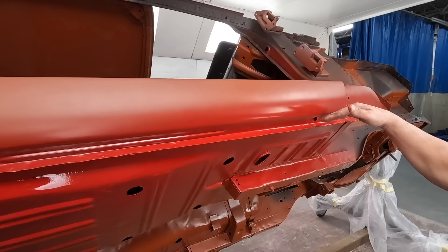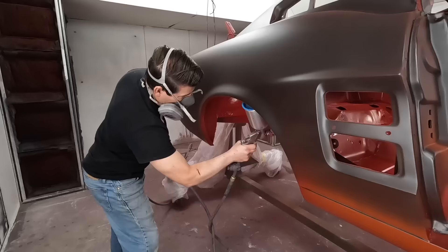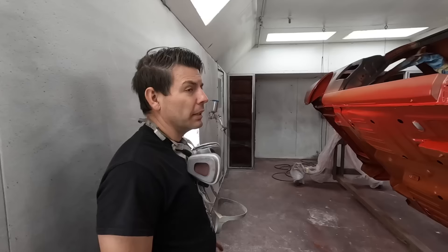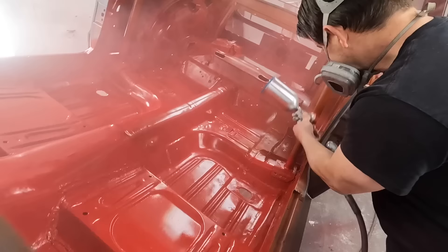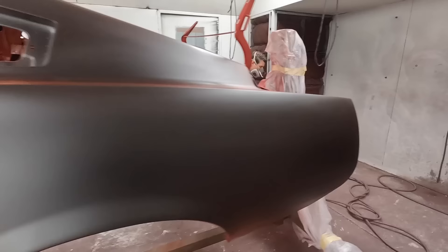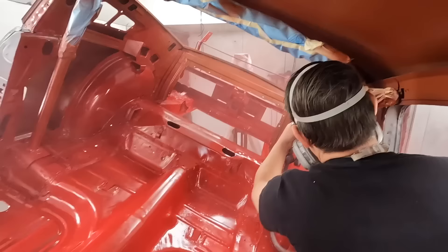See the overspray transitions across the floor pan - I'll go back and spray that black, and then you'll have black overspray on top of that a little ways. That'll have to be sprayed later, taped off and just sprayed. I have to put another coat all in the wheel tubs and the trunk area, and after that dries thoroughly it'll have to be clear coated. But it's as shiny as it is right now - this is basically what it's coming out like with clear coat on it. Then after that is sprayed and dry I'll mask the engine compartment off and spray the engine compartment.